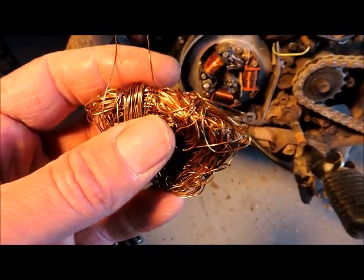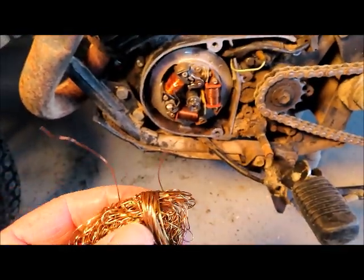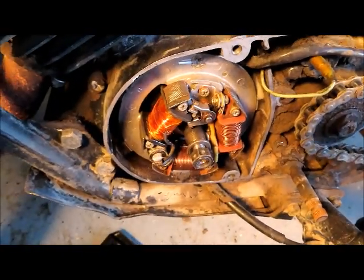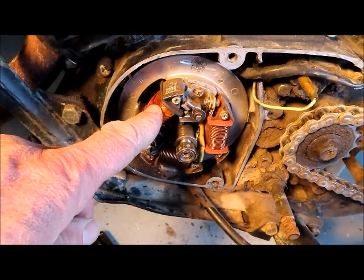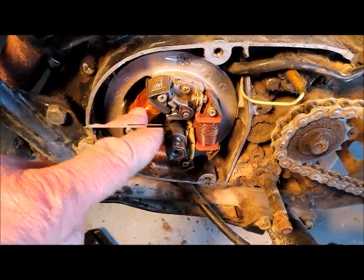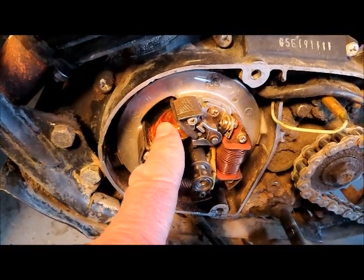Resistance is a linear function of the length of wire. This ball of wire — I coiled it up into a little ball and smashed it with the tail end of a plastic screwdriver handle — and I put my tester on the leads and it still said the exact same resistance as when it was loaded on the coil. So if you know the gauge of wire supposed to be on your coil, pull it out to a length that gives slightly more resistance than you need, then clip it down until it's perfect resistance. Spin it onto your coil, then tape it well with Kapton tape — this is high-temperature, very high quality tape. Put a bunch of layers on to keep it protected.